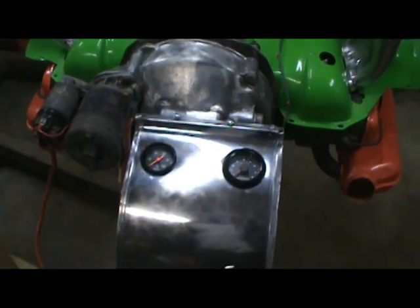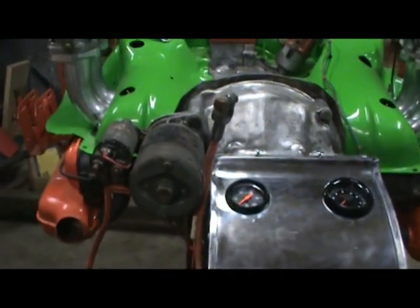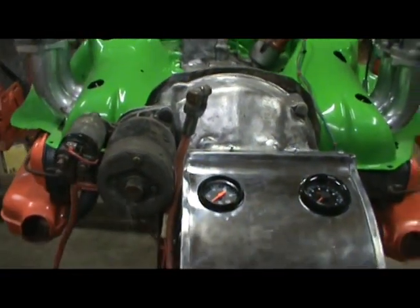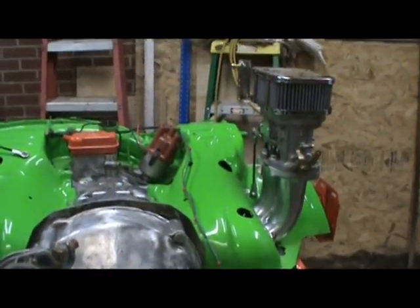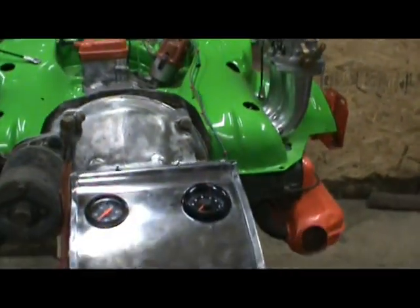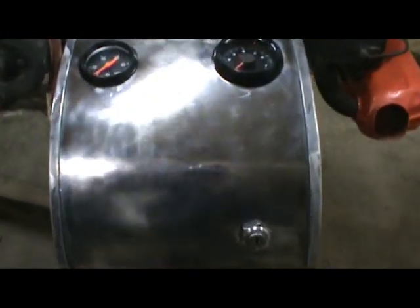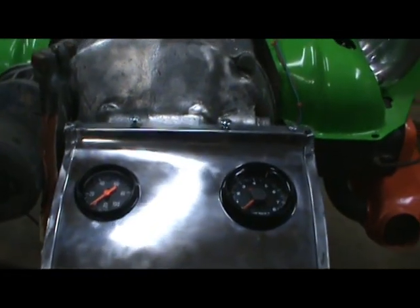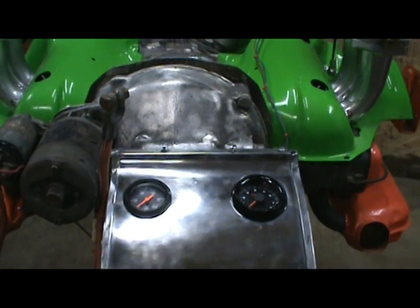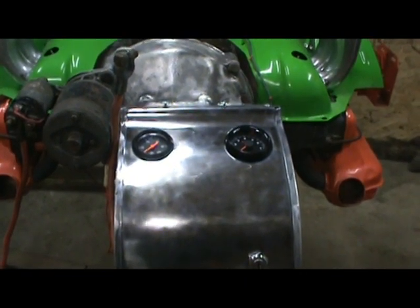Okay guys, here's where we are with the console for the test stand — been doing some wiring on it. I've got my starter wire, my hot wire that comes in here with my battery cable, the tach wire which goes to the negative side of the coil, and then I've got my hot wire, which is the red obviously — I'm going to power the coil. We're making some progress. I think it's turning out okay. It wasn't exactly what I'd originally envisioned, but things tend to morph when you're going through a project. I've just temporarily got it set on there with those screws — I really want to fasten it on a better way. I don't like the way the screws look, but we'll see what happens. I'm going to get back to work.